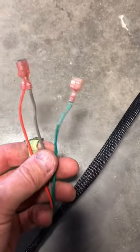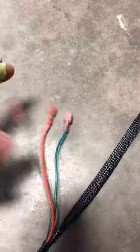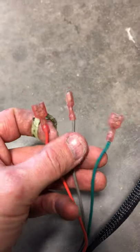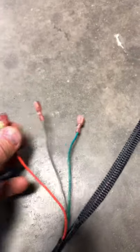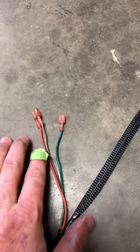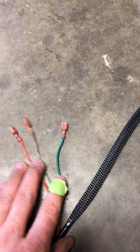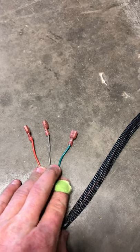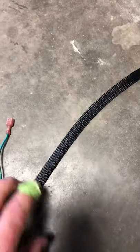The gray, orange, and green wires are for your forward/reverse switch. These three wires plug directly into the forward/reverse switch. Most other carts will have corresponding colors — I'll post pictures of the actual orientation so everyone knows where they go.